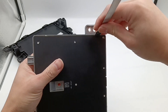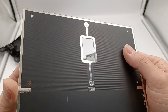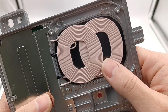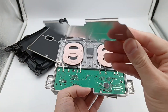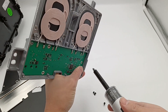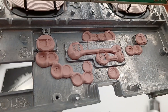Remove the fiberboard. Turn it back and take a closer look. The wireless charging area adopts a grid design to improve heat dissipation efficiency. Next, we can see the charging coil below, and the upper PCB is also covered with a metal sheet. Each part has two coils, increasing the charging area to be compatible with different devices. Remove the last metal sheet. The PCB is fixed with screws, and the solder joints of the coil are on the back of the PCB. There are lots of thermal adhesives to dissipate heat for main components, and the metal plate can evenly and quickly dissipate heat.